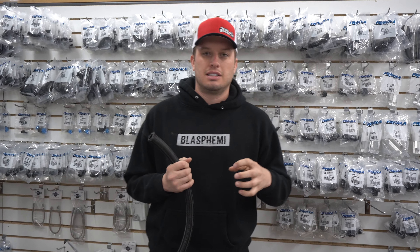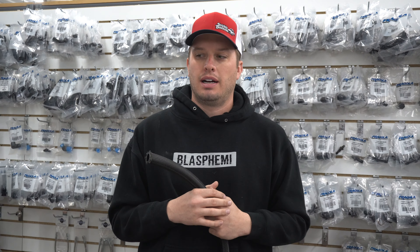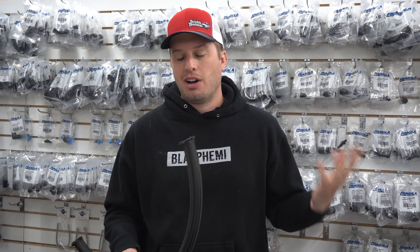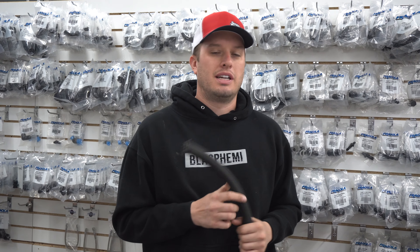Say you get a bad section of hose — and there's no brand that's better or worse for this — all of that getting into a 10 micron post filter is enough to just lock things up. When a post filter locks up, like a 10 micron micro glass filter as we commonly use with ethanol and methanol, all those pores get clogged and it locks up. Then the pump pumps against it until it basically shuts down and breaks internally. So you're either going to see lack of fuel at the dyno or the racetrack, or you're going to break parts.